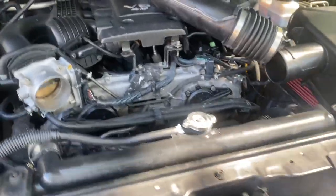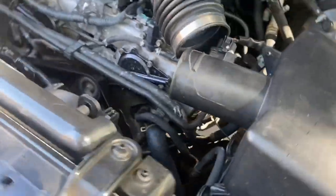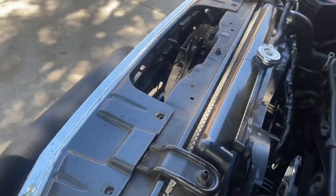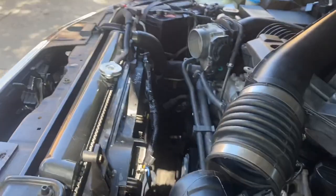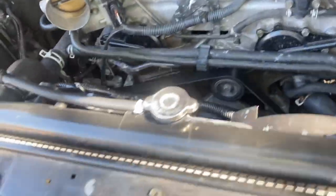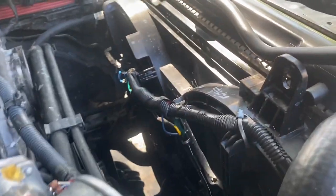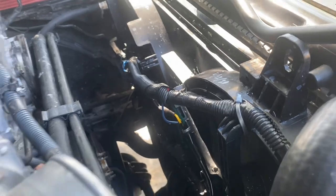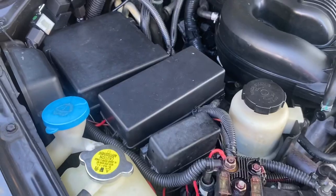Now I'll get into some wiring and how well they perform. I have these fans wired to high and low speed. There are two ways you can wire these fans for the conversion: you can use only the factory harness, or you can have two speeds like I did. The factory harness will kick on at either 208 degrees of coolant or when the AC compressor kicks on. I wanted two-speed action, so I have the medium speed hooked up to the factory condenser fan, and then I made my own harness for the high speed.